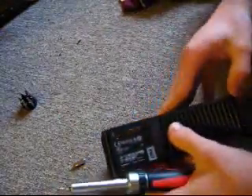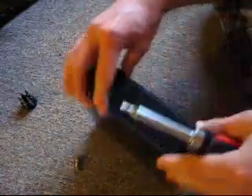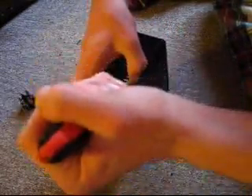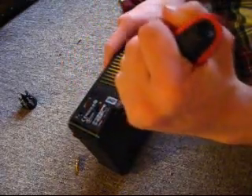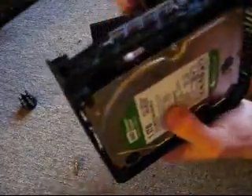Go ahead and use your small flathead to pop open these clips that are located on the back. What I recommend you do is, using your thumb, start in the corner. I recommend you start on this side because the hard drive is not over here — this is not the side with the hard drive. Then just kind of slide your thumb through, giving you some space to insert the flathead, and then slide back and forth a little bit to pop that out. Then repeat on this other side. Once the clips have been done, go ahead and slide the whole assembly out — just like that.